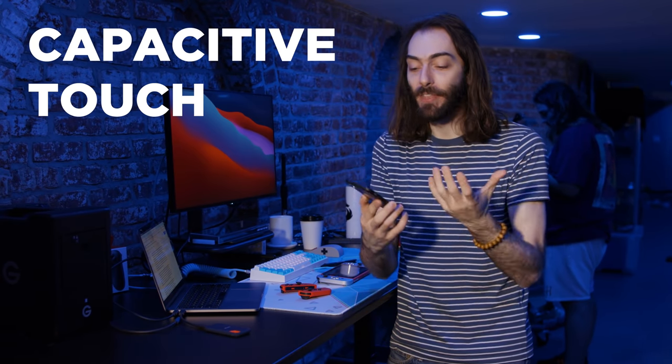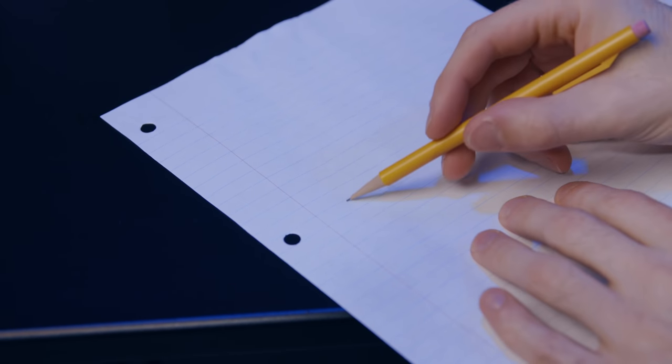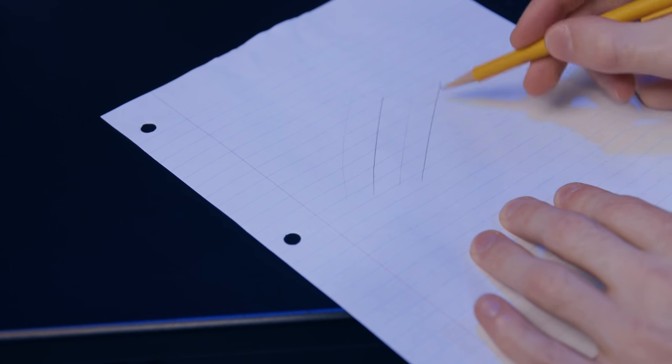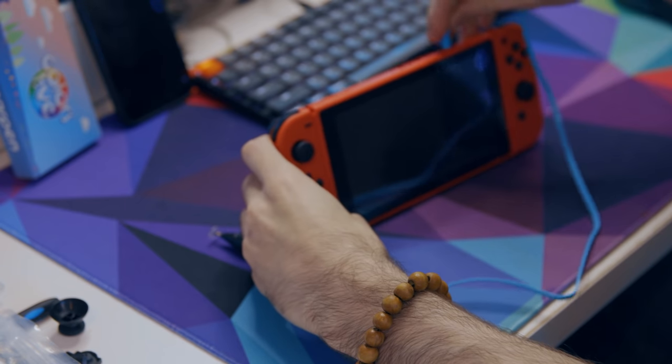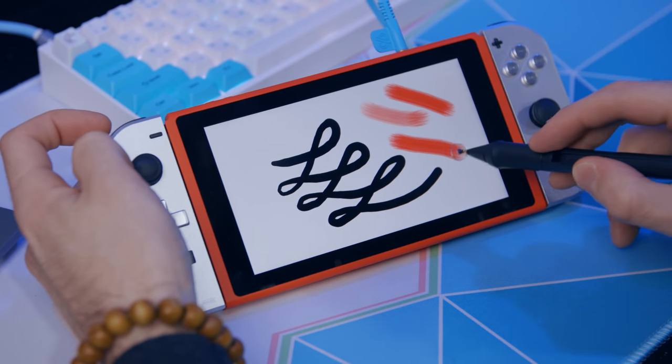So I'll try to give you the rundown on how drawing devices typically work. There are all different types of touchscreens available in devices, but your phone and the Nintendo Switch uses what's called capacitive touch. That means you can use your finger to move stuff around and press multiple points on the screen to interact with it. That is not very good for drawing because it's not very accurate — it's about as accurate as your fat finger. It also doesn't let you draw the way you would with a pencil or pen, where the harder you press, the darker and thicker the line. Luckily, you can make a capacitive touchscreen good for drawing — all you need is a stylus with some tech in it. That's where the Apple Pencil comes in, and it's also where the Colors Live Sonar Pen comes in. It's essentially the Kirkland brand Apple Pencil. It plugs into your headphone jack and sends the Switch a pressure signal, letting it know how hard you're pressing down, used to make your lines thicker or more opaque or both.